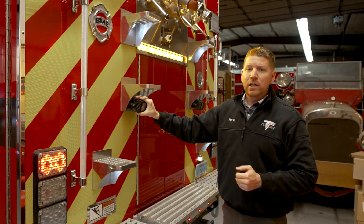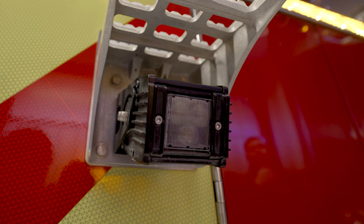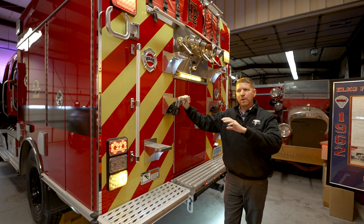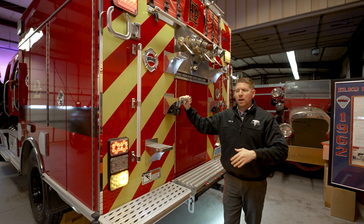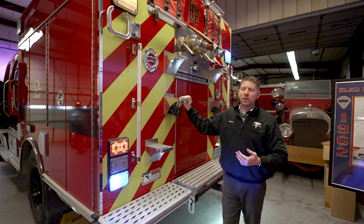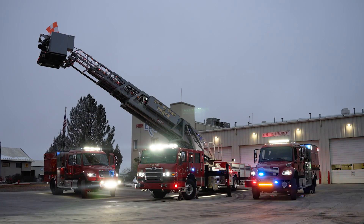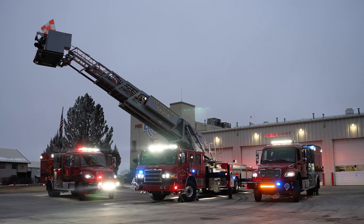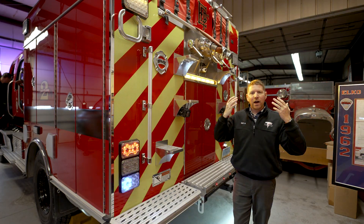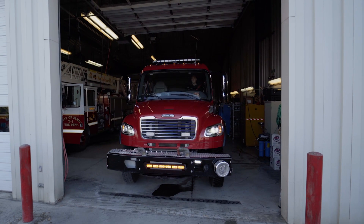This is our TRX series — TRX stands for Tomar Rugged Extreme — and it's a perfect light for wildland trucks. The TRX series is adaptable: it can do multiple colors and multiple modes, including white and amber illumination. The crews have been talking about how helpful it is for the 30-inch TRX bar in the front bumper to override to amber, which doesn't refract back on the operator's eyes the way white light does. This is useful not just in fog but in smoke and dust as well.